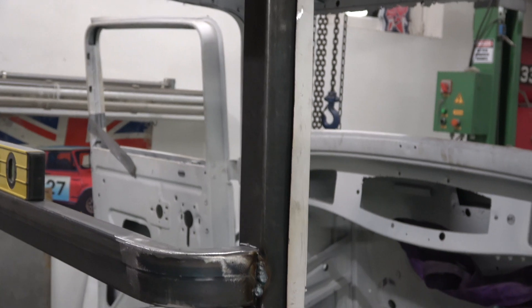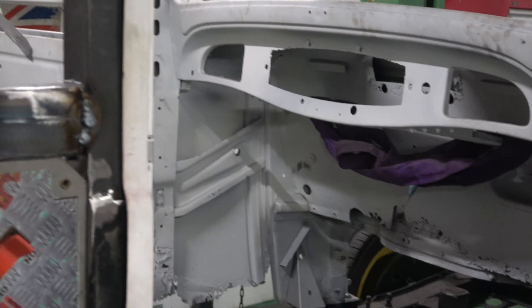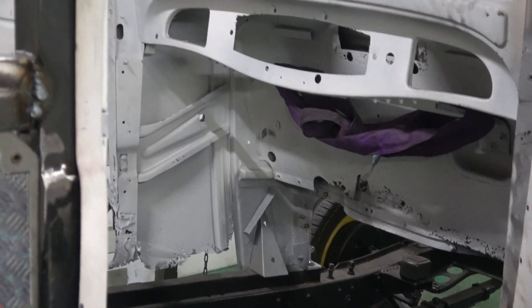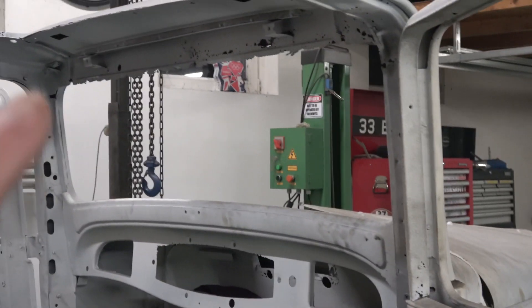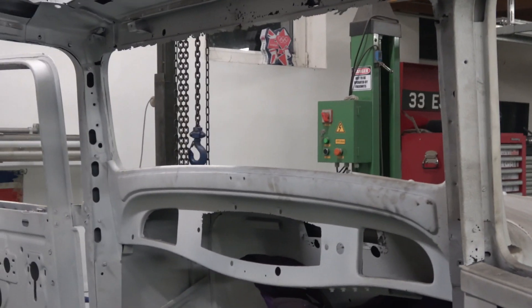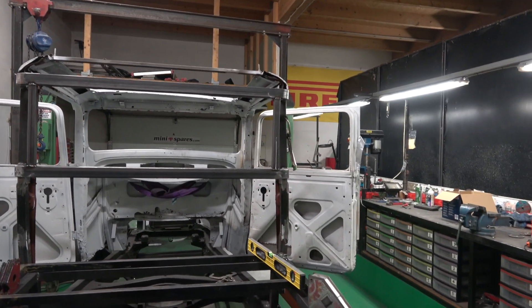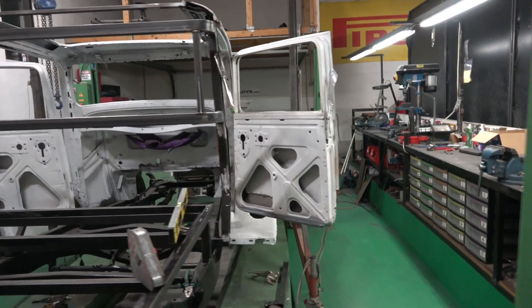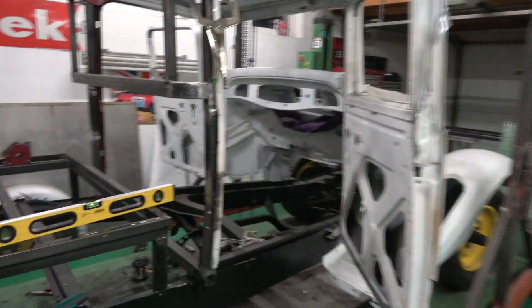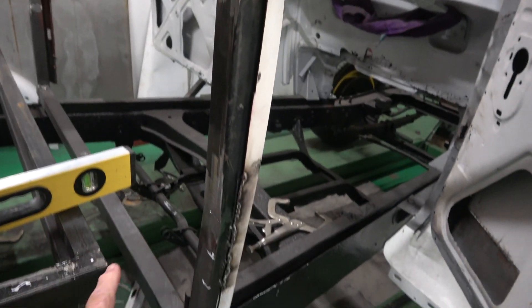Just tacked it in. I spaced it out that way for a couple of reasons: one for this body line, and secondly I want the window approximately the same size as the one in the front, which is 27.5 centimetres. I can fit a 27.5 centimetre window in this with the beading around it as well. Within that picture frame is where the back window will go, and they are 35.5 centimetres between each bar.